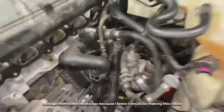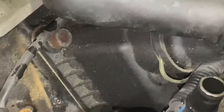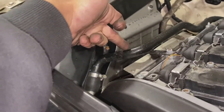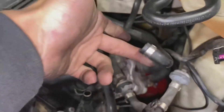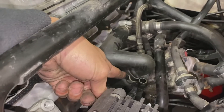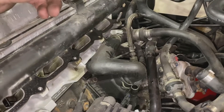This is how it's supposed to come from the factory. Conveniently enough, I have a stock version of that car sitting right here. So you have this plastic piece coming off the block breather — it goes to a T. One end loops around the block and goes into the turbo inlet pipe. The other end just goes onto the intake manifold. So get rid of all that. I have a 10AN fitting right there and it'll go straight to a catch can. It's cool that Integrated Engineering makes that.